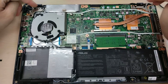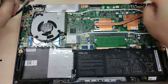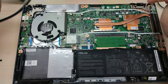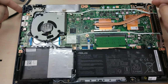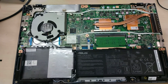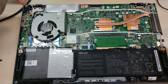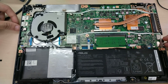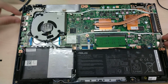Our hinges are here and here, and then the display plugs into here, and there is actually grounding for the display into the hinge. The charging jack is this, and it is soldered to the motherboard, so if it wears out you will need to resolder a new jack onto the board, and so is the HDMI and USB 3 port. The activity LED, micro SD card, headphone combination mic jack, whatever you call this, and dual USB 2 ports.